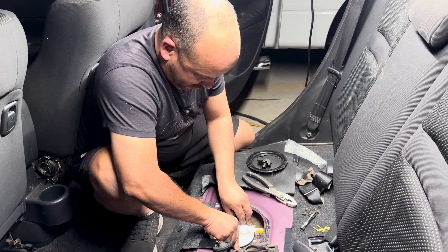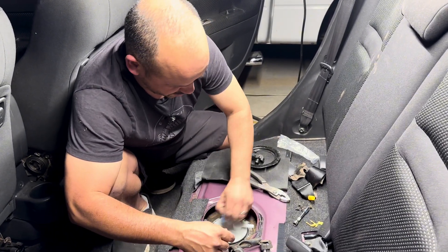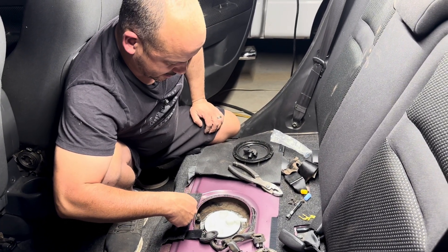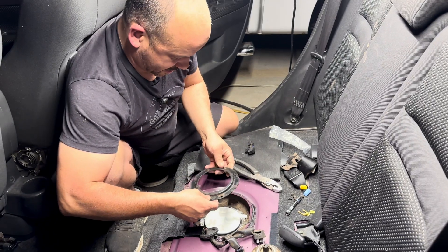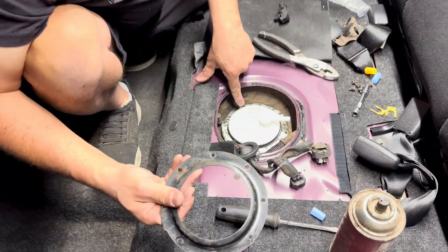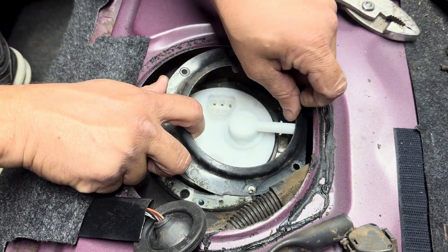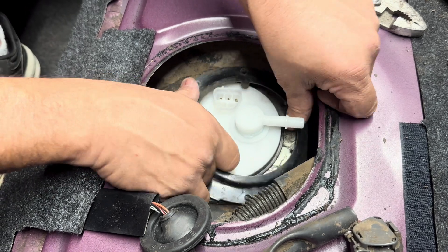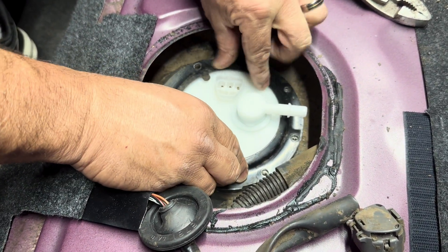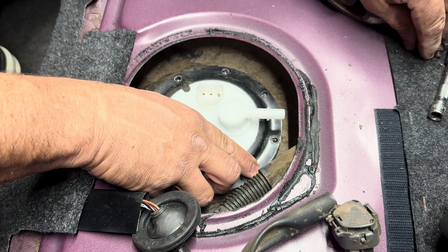Voila — put this in here again. That's a lot better. Go ahead and take this plastic off because once it gets bolted in there it's going to be a lot more difficult. This goes on next and it has a tab that matches up with a little notch right here, so I need to slide this on, line up the tab — and yeah, it fits. Then put the bolts back in.